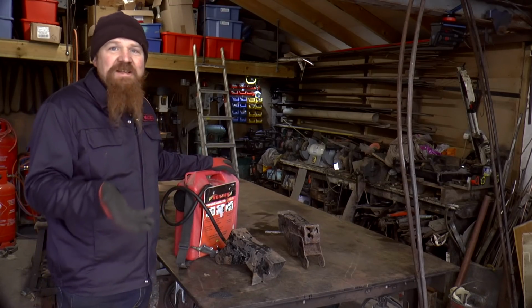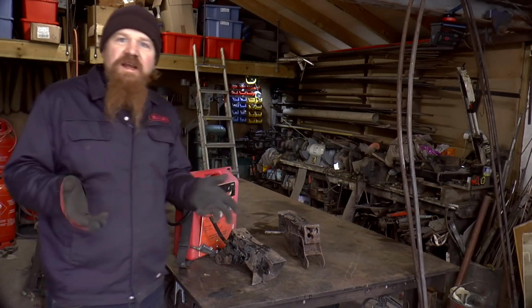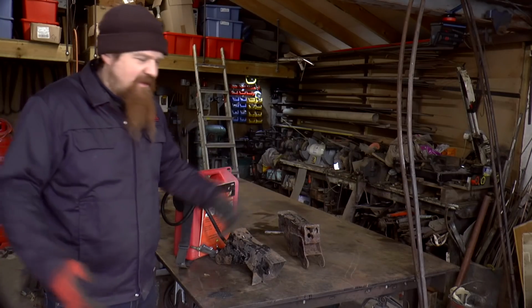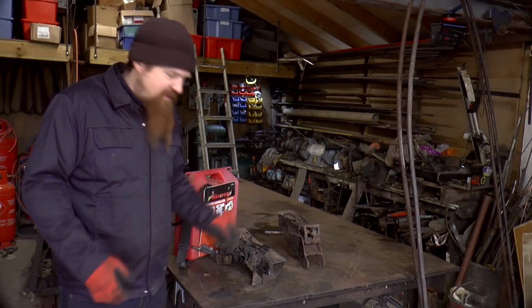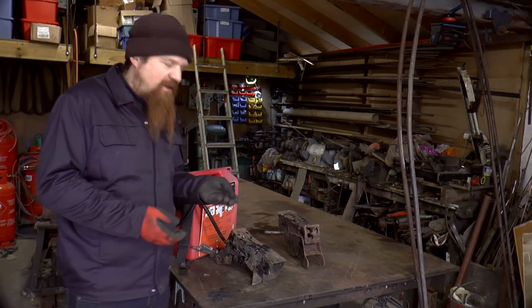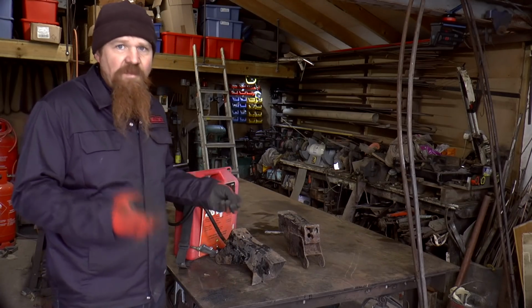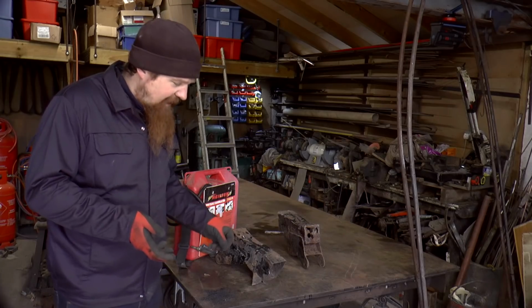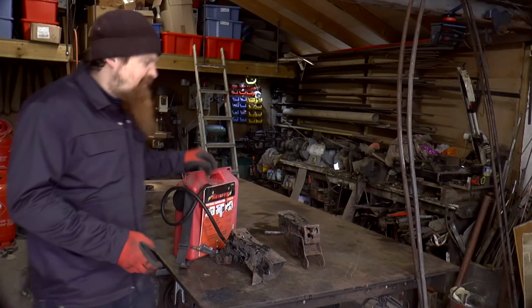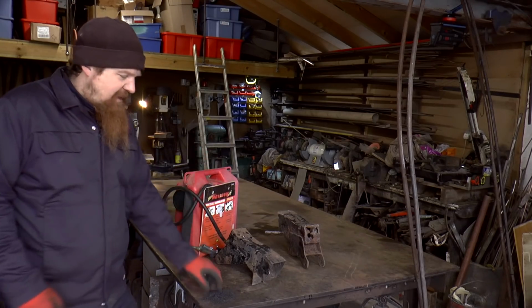What is much less well known is it's quite ineffective. So I've used sand to blast paving slabs because it was a cleaner process than this stuff, which back in those days you couldn't really get the glass grit. So I was using this black stuff here for doing ironwork, which it's really good at, but for doing stonework it tended to darken it too much. So I used sand on that, and what I discovered is that sand is about half as effective as this stuff.